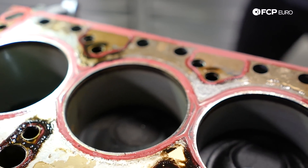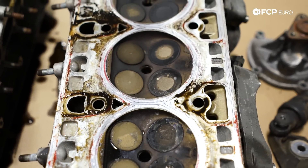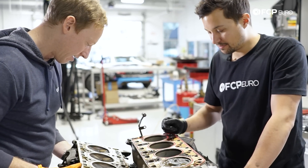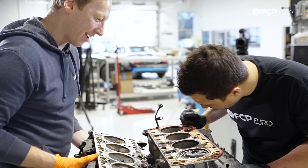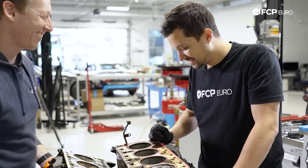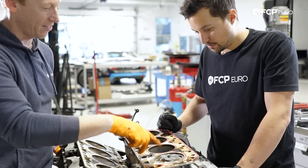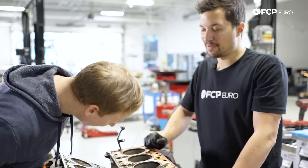The valves are clean. The head's totally fine. Still got about two millimeters of water in the cylinder — it might be more than that. And shouldn't that piston be up all the way? Wait a second — I'm pretty sure this piston is supposed to match that piston. These cylinder walls look great. It just never made it up.